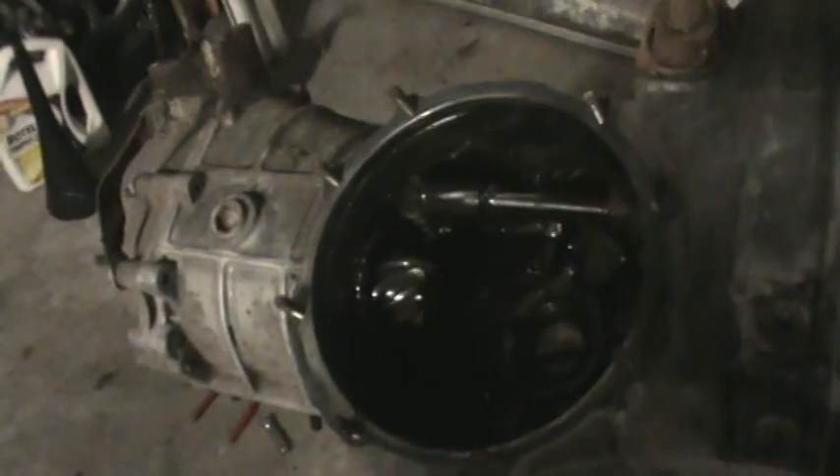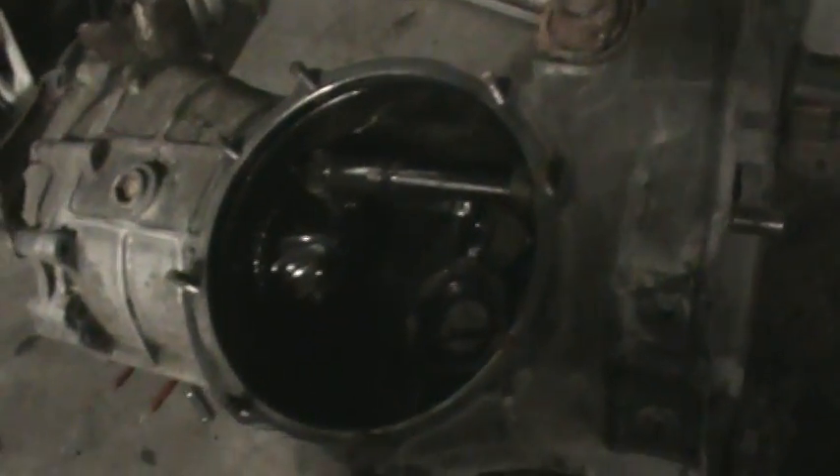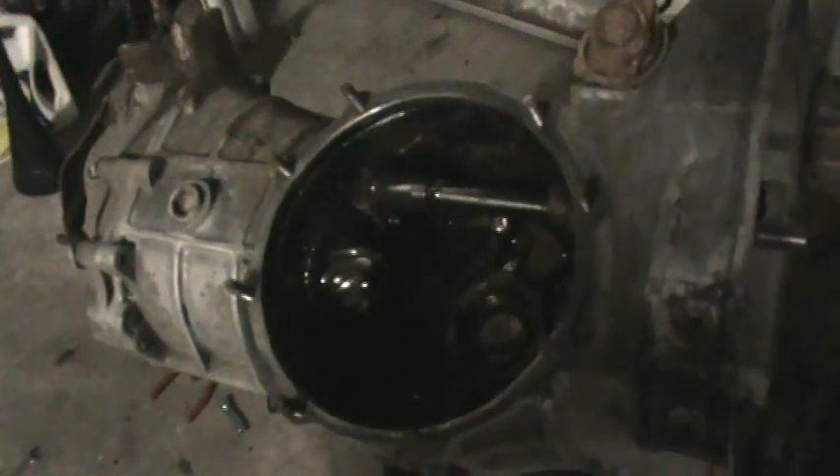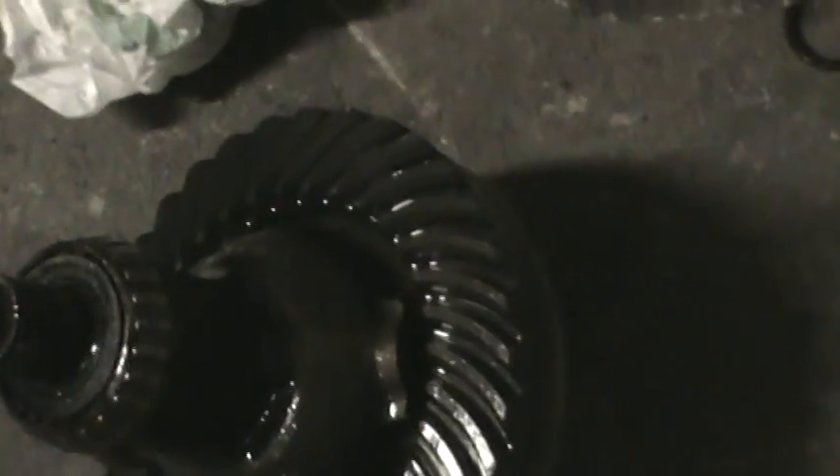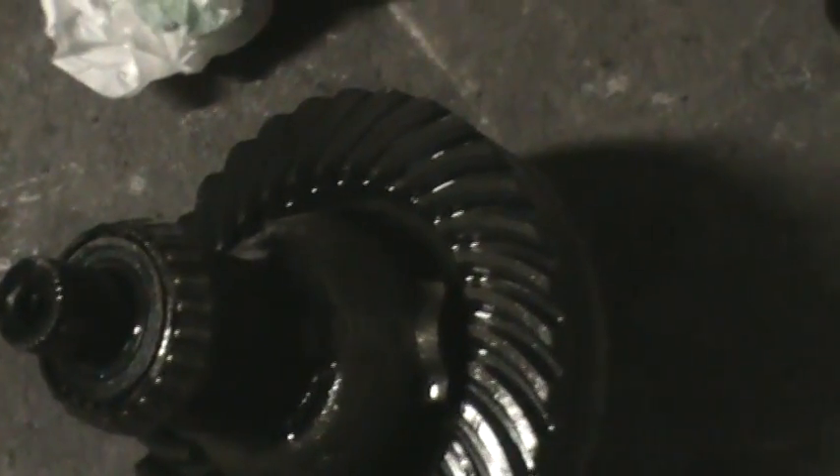I got the transmission part two today and it's not what I wanted to find - this is a 4.12, not a 3.88. They want to drive this on the highway and go to shows, so this is sort of an in-town box. It's a 4.12 ring and pinion - 33 on the ring gear and 8 on the pinion, which makes it a 4.12.